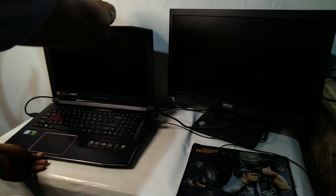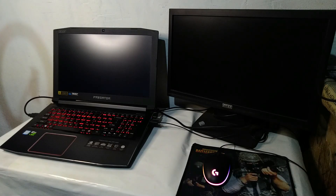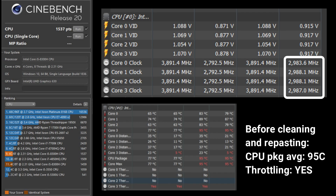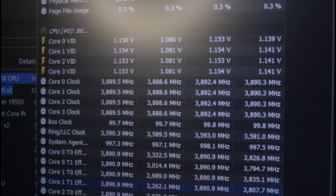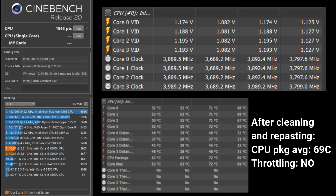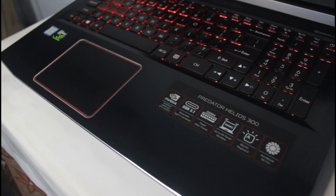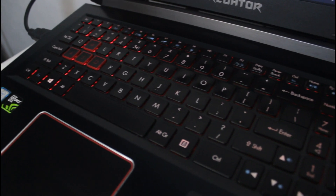Let's boot it up and run CineBench. Before cleaning, you can barely see 3 GHz all-core with 95°C average package temperatures. After cleaning and repasting, you can see nearly 3.9 GHz all-core and a massive drop in CPU temperatures — almost a 25°C drop. The final results show a 35% drop in temperatures and 28% higher performance. This is now actually better than the Core i5-9300H and only slightly slower than the Core i5-10300H, which is quite amazing. Remember to clean your laptop — dust is your biggest enemy. Don't be lazy and clean it every 6 months or so, especially if you live in a dusty region.